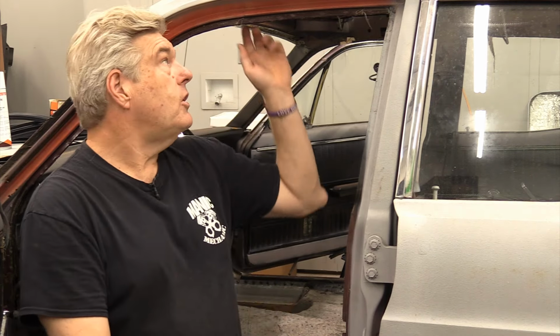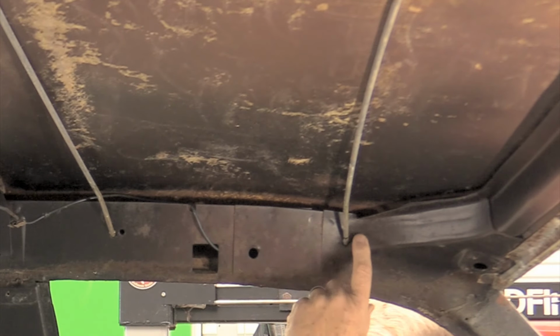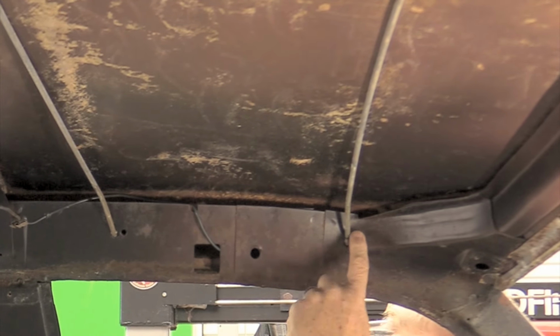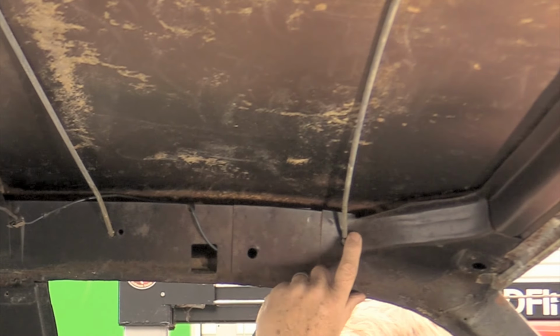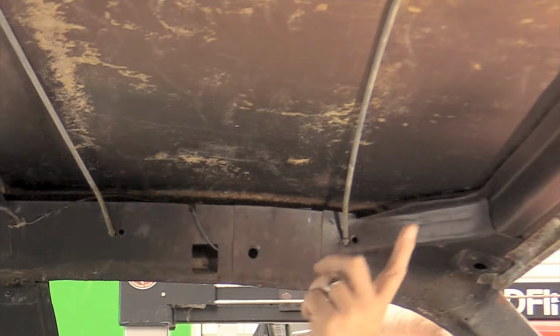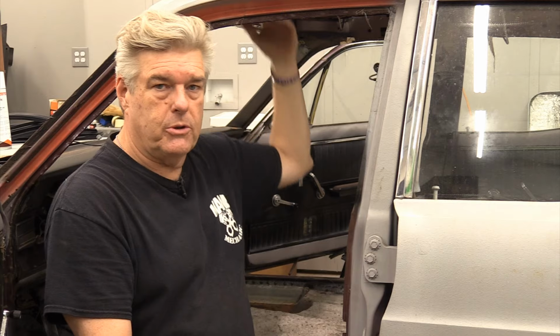You can worry it out because typically they go from a smaller to a larger at the back. And I mean by that, the bow droop from center is greater the further you go back in the car most of the time. There's also, as you'll see, two hole positions here. There's one here and one here. If you're a taller guy, you can try putting the bows in one side higher up. Nobody's going to be able to notice that when you have the car done. And that'll give you a little bit more headroom on the driver's side. I typically leave them right where they're at.